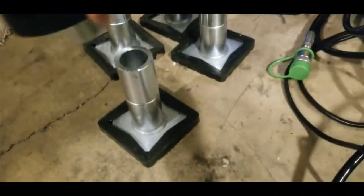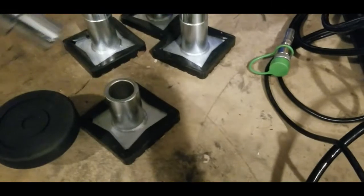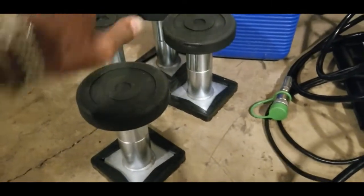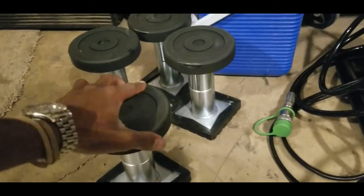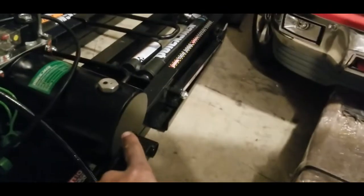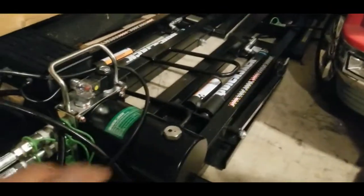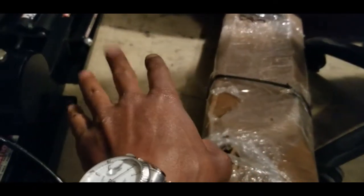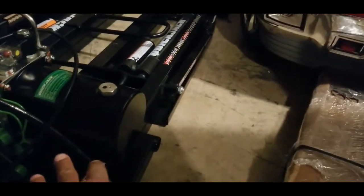But it's the lift, and these extensions are for lifting up a truck, or just a tall car or something, whatever. So it's these 5-inch extensions. If you lift something that's already a little bit lifted, it's got these extended frames. So if I'm lifting something where the jack points are too far away, I can add these on there. But you have to be a little higher up in the air for it to work because it raises the height of these rails.